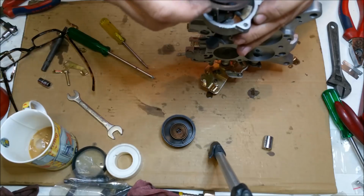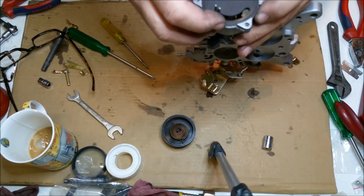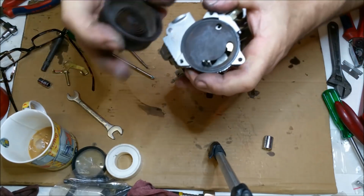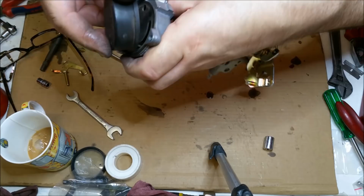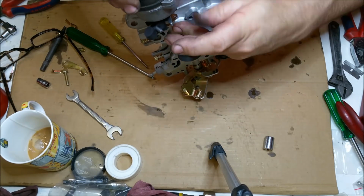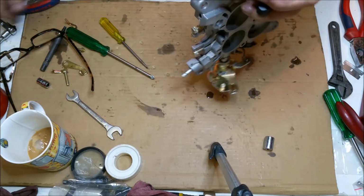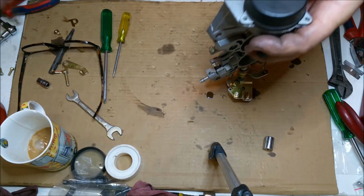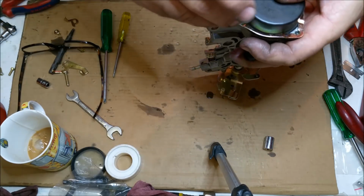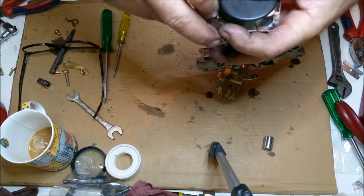So the gasket, this is a second-hand gasket because we're scunging out. We're not putting a new one on. There we go. And we've got to make sure the coil sits over the split in the gasket, and then we just turn him back, and that will mean the choke's active. It's a stepped ring that goes over like that with some screws, and that makes us a happy boy.